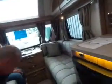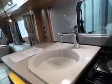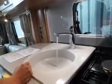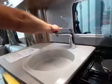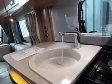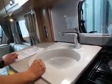Before getting water into the van, first check all taps are shut. Then check your drain is in the correct position, and switch your water pump on — you'll see a little green light come on. Open the taps to get the air out of the system. If you've drained the water system previously, all the pipes will be full of air, and the pump will push the air out through the tap. It'll be spluttering quite a bit until the air is cleared.